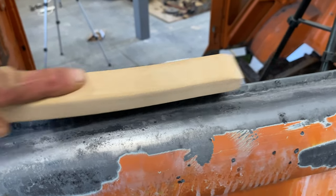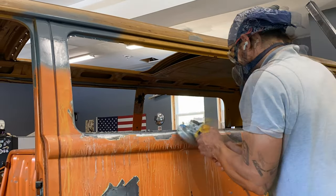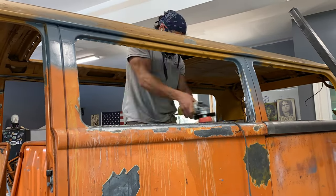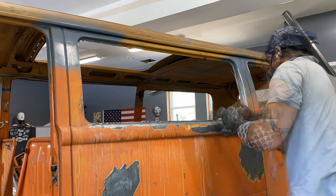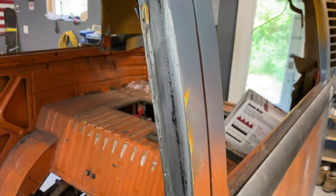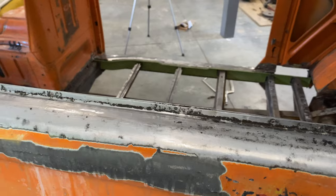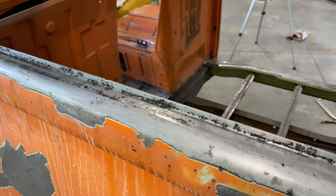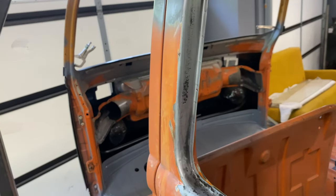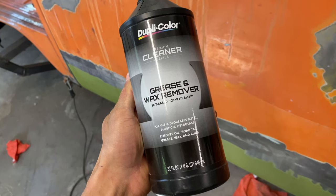With anything that was once rusted or had pitting, I like to use POR-15. POR-15 is all about the prep work — you want to make sure your surface is ready for adhesion. That's why I make sure there's no loose material on the surface, and then I'll use the POR-15 metal prep. This neutralizes the rust — you can see all those little black dots are where there was rust and it's now neutralized. When you leave it there long enough, like the instructions say, you'll actually get a bit of surface rust, which is what you want, as POR-15 adheres better to a rough surface than a smooth one. Then use wax and grease remover to wipe it down, and it's ready for the POR-15.